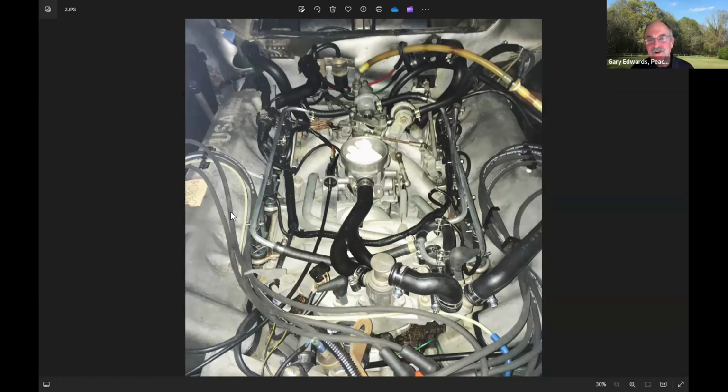But put all that together, and it just really didn't help the car run much better, which was pretty disappointing after all that work. So I went ahead and replaced the spark plugs and the spark plug wires. And almost by coincidence, since I had laid in a new manifold pressure control sensor off of eBay as part of my quest to make sure I had spare parts for the car, I rotated that in just to test that it worked. And the amazing piece was the part throttle drivability issues went away. So that was actually caused by the MPC sensor. That was refreshing, but the idle was still pretty bad. And the MPC sensor, I don't think, controls it at idle anyway. So then I had to continue to press forward.